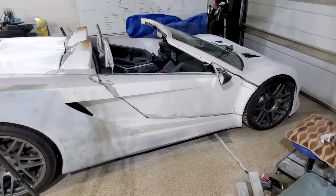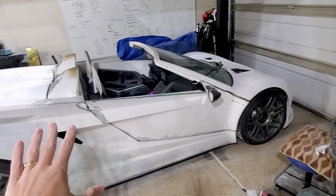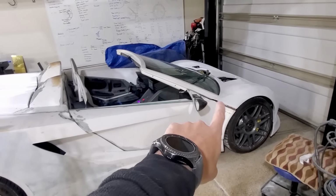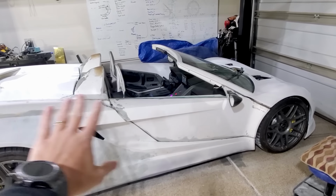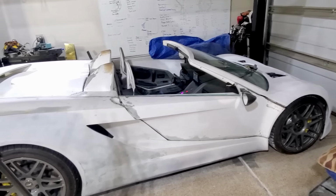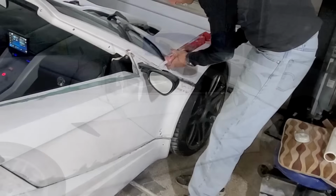We're going to go ahead and get the passenger side ready for paint. Okay, I have backed in. I'm now going to focus on this side. Again, do some of the same things: fill with short strand fiberglass filler in other spots, do the guide coat, sand. Hopefully, from what I've learned last time, this should go a little quicker.